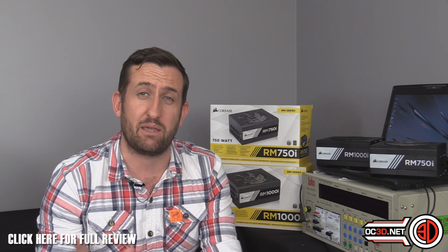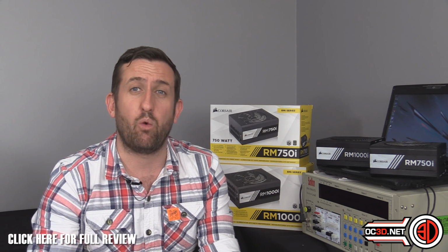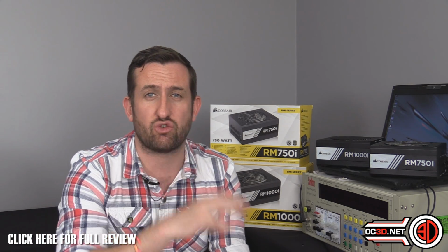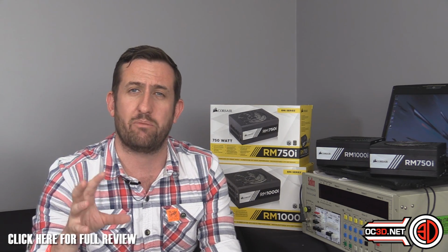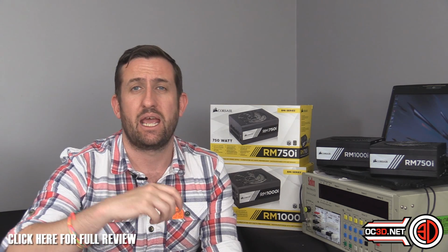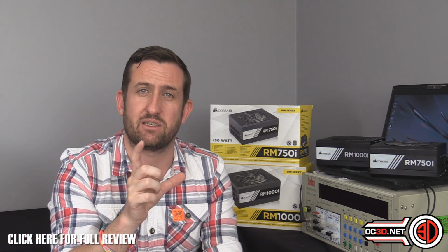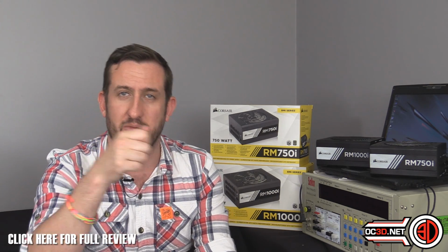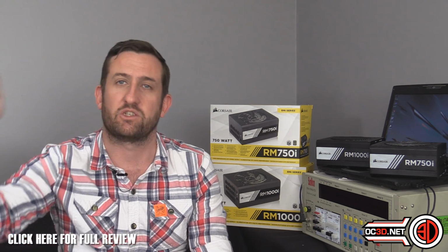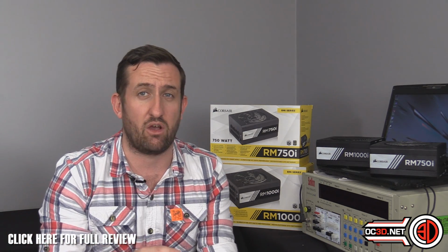Then they're saying that they're rated for full output at 50 degrees C, whereas the original RMs were only 40. It's actually got a digital output on it now. It's not digitally controlled inside, but there's a digital output on the power supply so that you can use Corsair Link. You just plug the cable in and it goes straight into your motherboard, whereas with the original RMs, you needed an analog to digital converter to plug into it, which then you plugged your cable into, which went into your motherboard. So it gets rid of all of that.